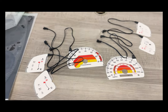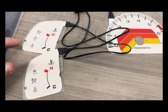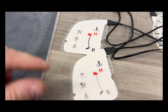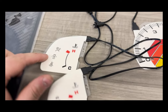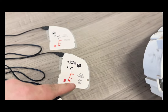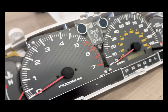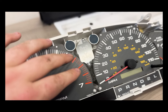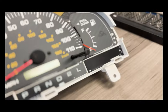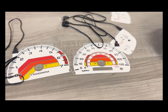The new gauges — the two side panels come with two different versions, so you're going to want to match up which one you have to each panel. This vehicle doesn't have the traction control light, so we are going to use the panel without it. There are also two different versions for the other side: one has the four-wheel drive light. If you have a two-wheel drive or the four-wheel drive indicator in the center, use the one without the four-wheel drive indicator. Just match everything up to what you already have.